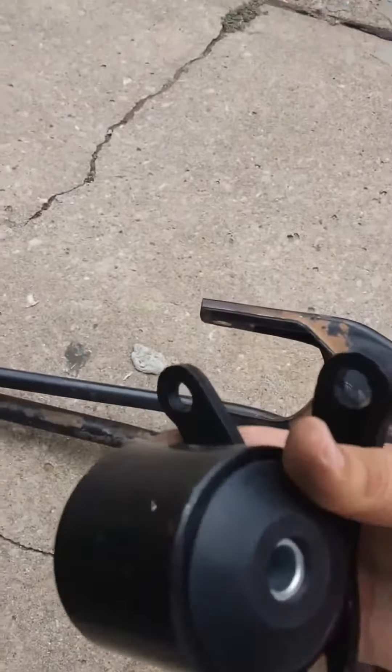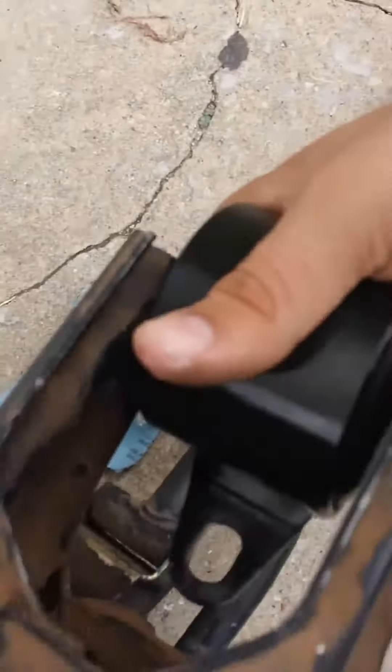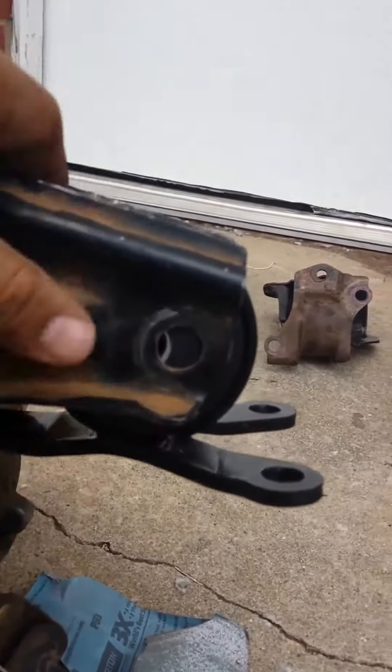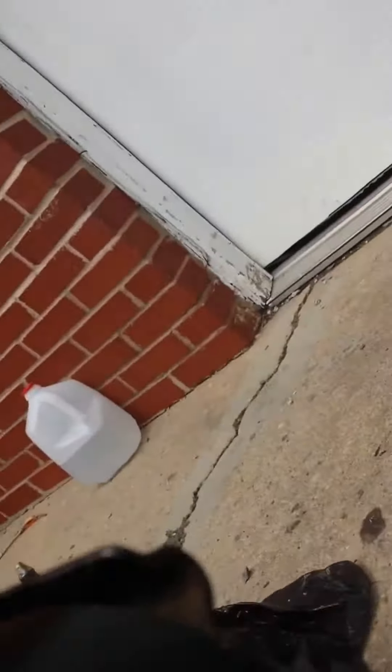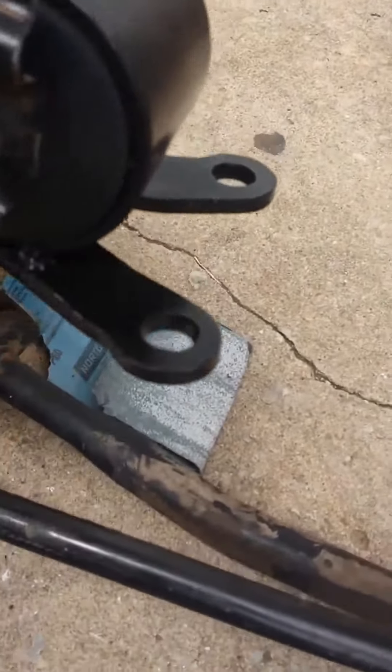Here's the t-bracket I was talking about. The motor mount will slide in — here's the Y mount, here's the bracket, and it'll slide right in like this. There's your bottom mount. It would be best if you put the mount in the engine bay first and bolt it on, as it'll be hard to get through that bolt otherwise.